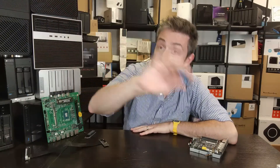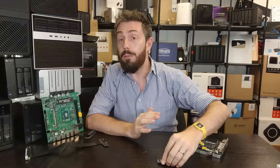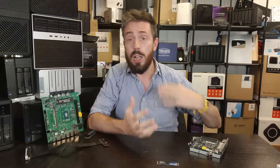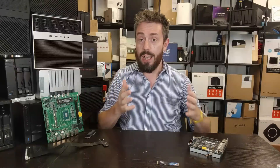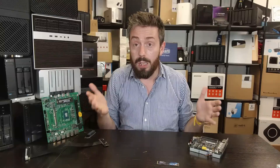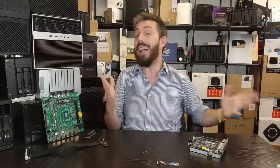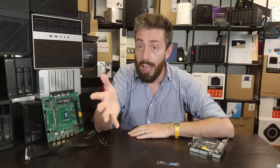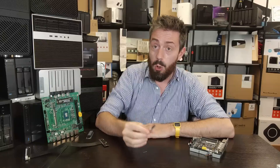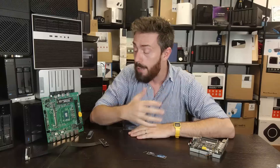The size, shape, and angle of these adapters differ, so factor that into your chassis design. But it allows you to take advantage of a smaller M.2 slot typically reserved for a Wi-Fi card and, via this PCB extension, add a traditional M-key M.2 NVMe. Bear in mind your system software may need attention — sometimes in the BIOS it'll be locked to a Wi-Fi card — but it's a way to turn a relatively unpopular M.2 use into something more useful.